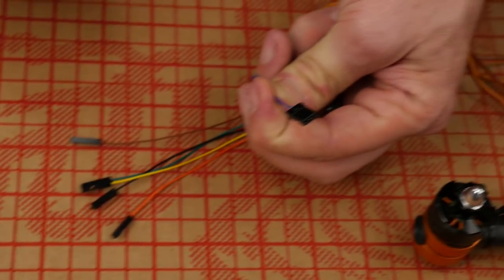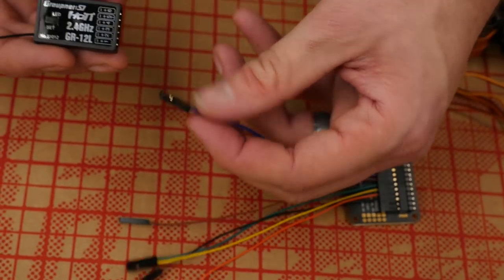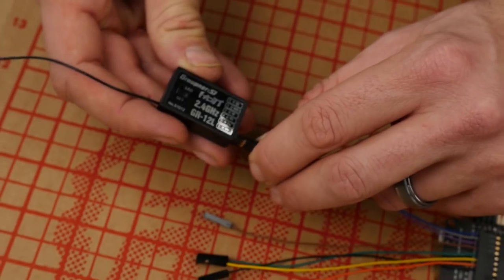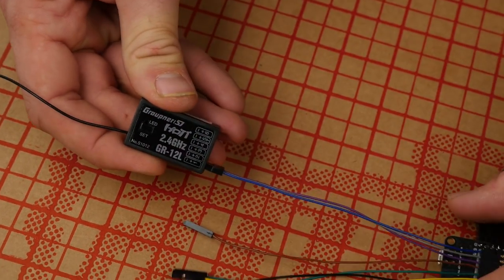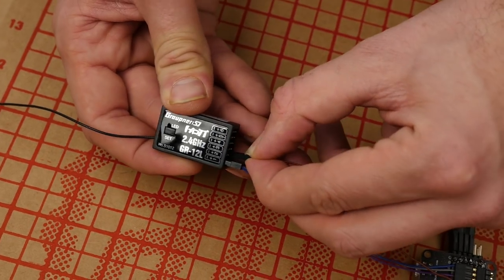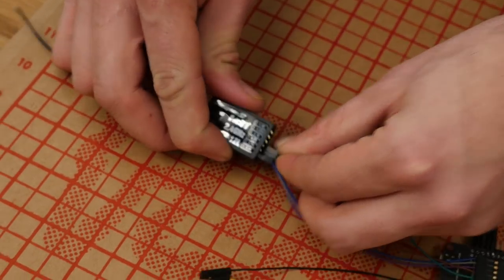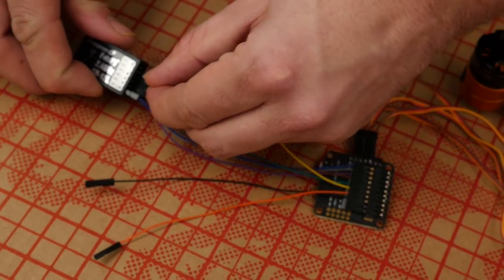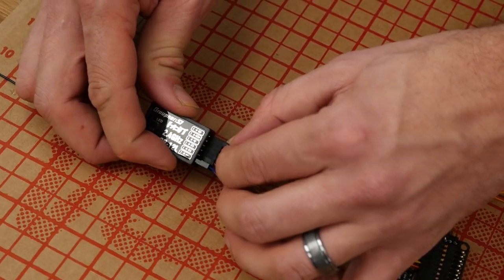Keep in mind where the signal wire is — in this case it's on the very bottom. Make sure you put your signal wires on the bottom and ground on top. The only connector that has the ground is pin number 1, the three-prong pin. Blue is the ground and purple is the signal. Flip that so it's pointed the right way. From there, brown is number 2 on the bottom, then green, then yellow, then orange, then black.